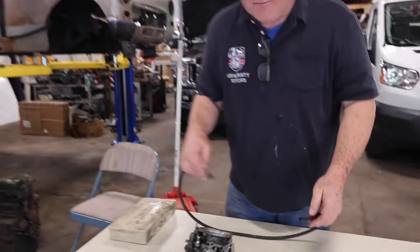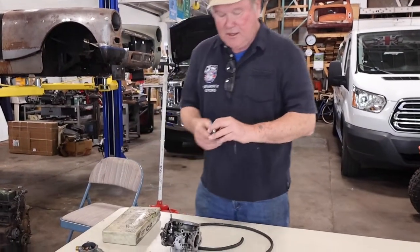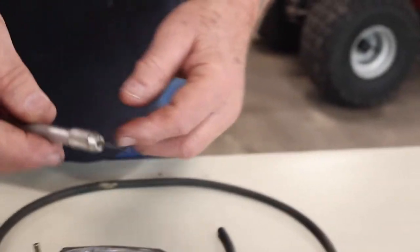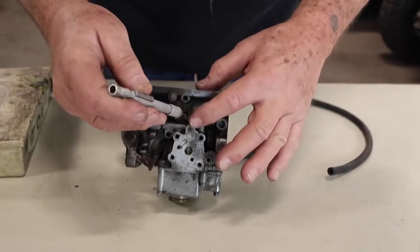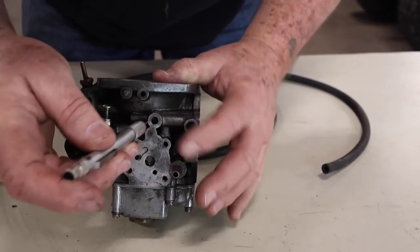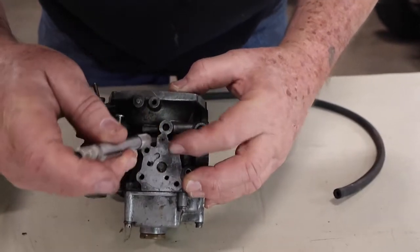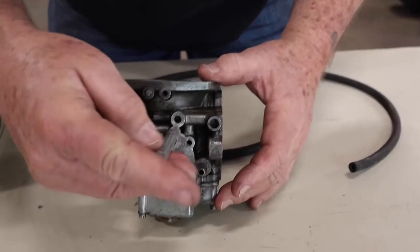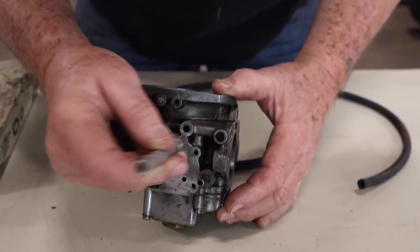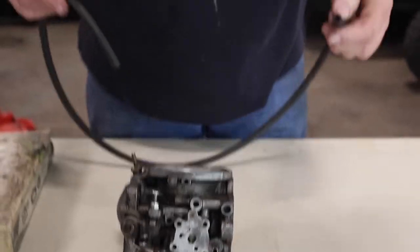That's easy. If there is not a vacuum, then you get out of your Stromberg toolkit this little drill — this is a 35-thousandths drill, 15 gauge piano wire — and you put that right into that hole. Easy for me to say. Clean it out so that when it is running, yes, you do have vacuum. That's important.